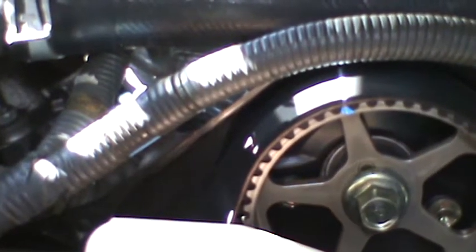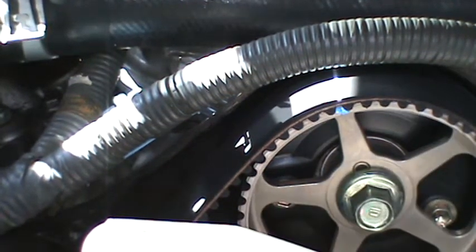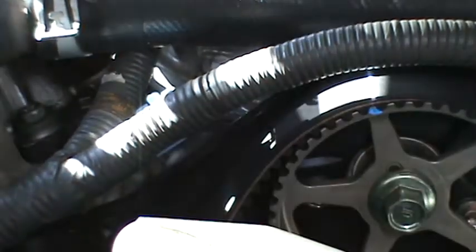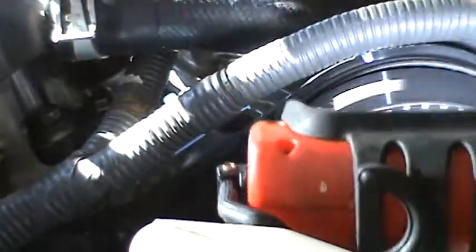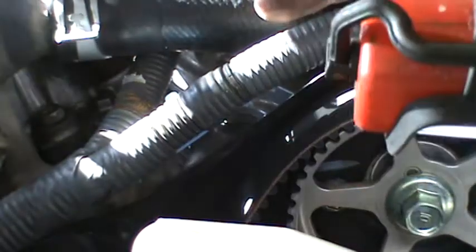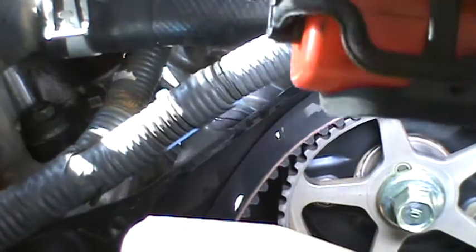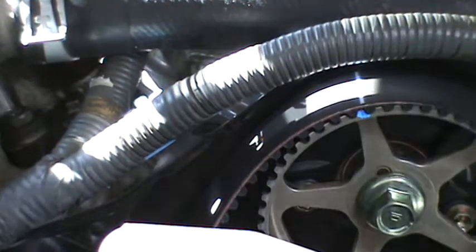So I just turned this back just a little bit, and then I'm just going to do the same thing in the back. Right there, I just turned this one tooth this way, put it on, and then tighten it back over there. I'm going to double check the bottom — the bottom looks fine. So as long as this line's matched up with that, you're good.